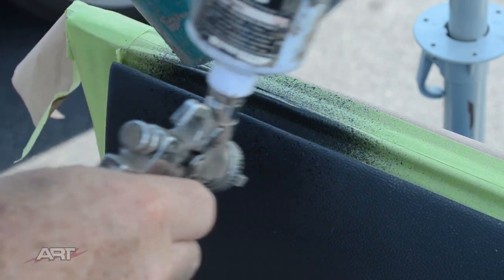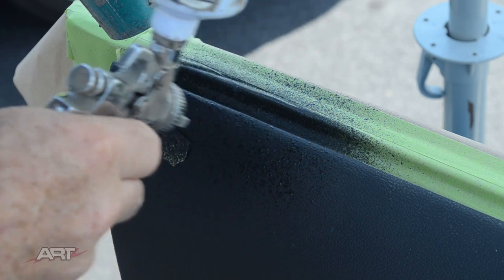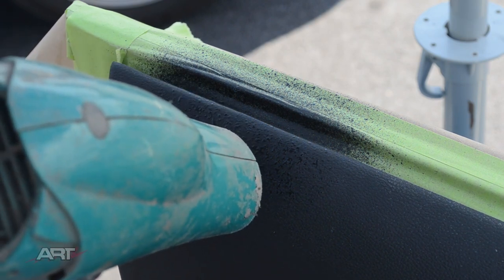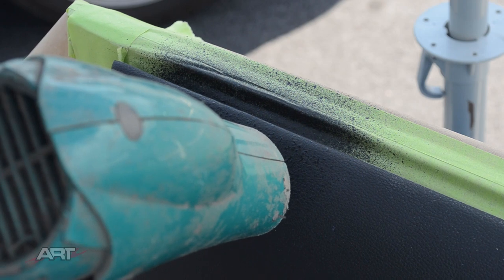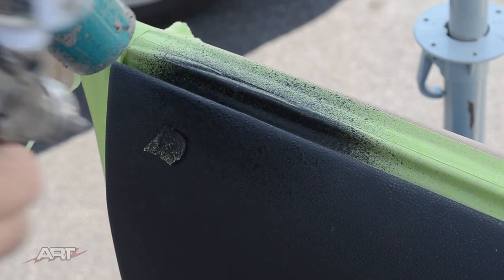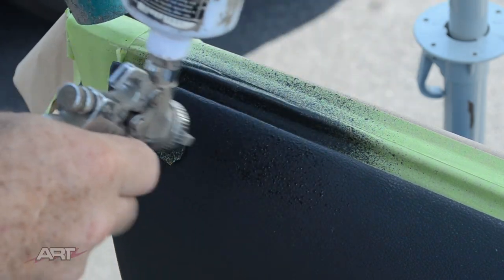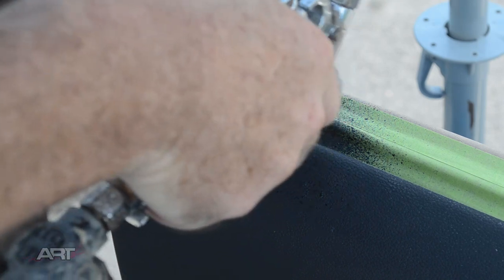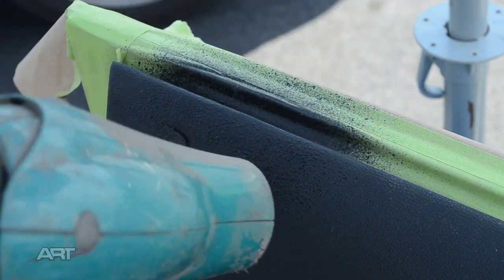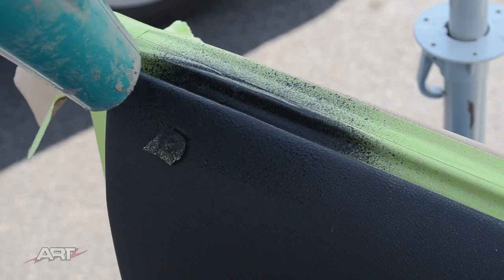When you do this, the texture looks too big because if it's going to be that wide and that heavy, it's going to be too tall, wouldn't you think? You'd be exactly right. It is going to be too tall, but because we have firmed up the texture with the plastic primer, then we can sand off the tops of it and be left with just a wide base. So we're going to put a few applications of the wide texture down with a view already to sanding the tops off. So initially, that might look frighteningly large for a texture, but we move on.